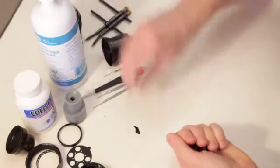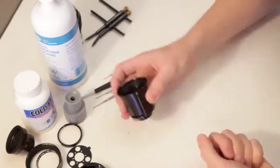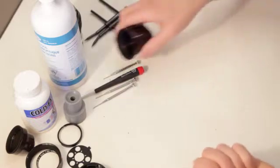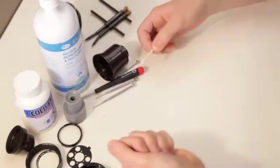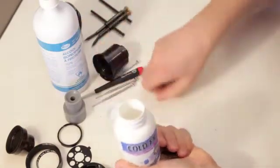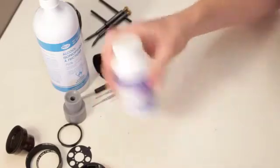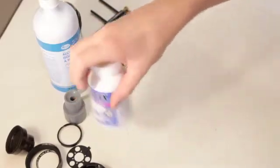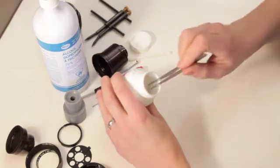Here's something I want to show you guys — just be aware: this element sticks out really far, so do not scratch it on the bottom. Always be holding this and don't scratch it on your table. I'll show you some tricks I've come up with. You can use 70% alcohol and a Q-tip and clean all the blades, or what I'm doing now — I'm cheating, being lazy — you can throw it all into a bottle; it's all alcohol in there. Just throw your blades right in, close it up, give it a shake. They should come out clean. I'm gonna collect these back out with some tongs.